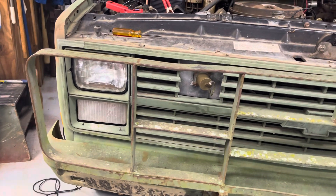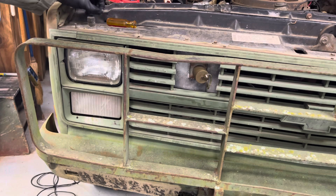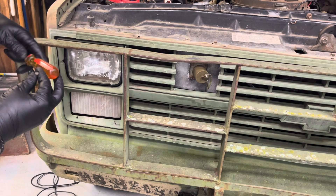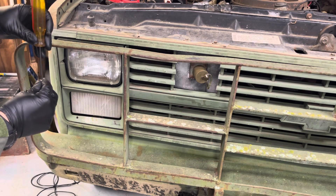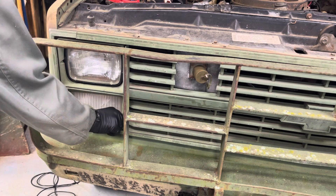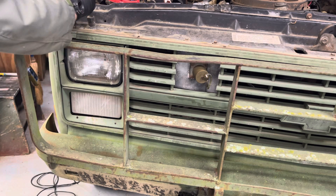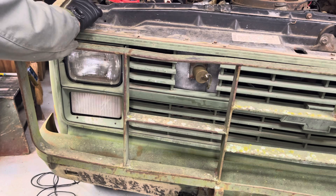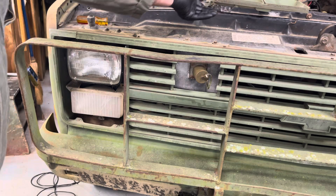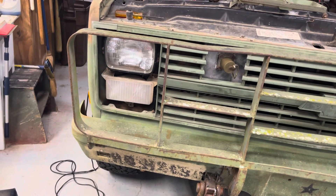Move the camera over a little bit. First you've got to take the surround off. There are four T15 Torx screws. I've already pulled two of them out. There are two down here and two up here, all the same size. Don't worry about keeping them separate — the surround comes right off, and then you're down to the blinker light.